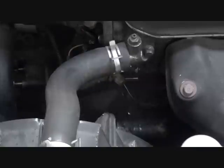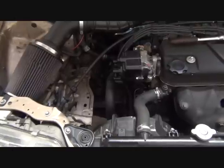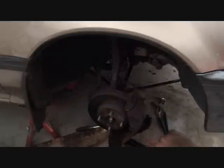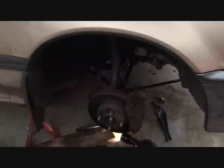And so then you want to jack things back up into position and start attaching the mounts. And again, don't snug anything down on the mounts until you have it aligned, all the holes are aligned and the bolts are in, and then you can tighten them all down together. And once your motor mounts are secured in place, then you can reinstall the axle shaft, and then the ball joint will go back in place, put the fork back in place, and so forth. Just kind of reverse of the removal process, and torque everything down.